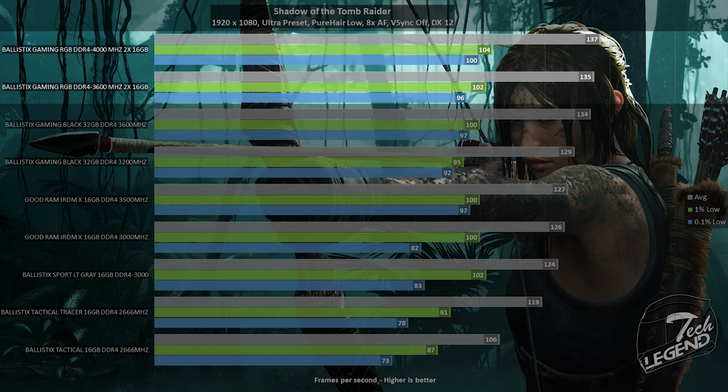This shows why it is important to have good timings and good frequency rather than just have high frequency but bad timings. Obviously, more performance can be gained by lowering the timings and adjusting the settings in the BIOS for the optimal balance between frequency, timings, and of course voltage. But that takes time and is not really that relevant in our review because each RAM kit overclocks differently.